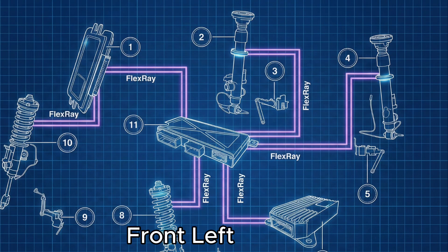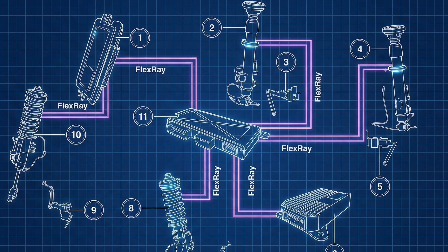And by doing that, you've killed the entire path — you've got an open circuit on that resistor. It's just like CAN bus: if you've got an open circuit, it ain't going to work. So that's why when we induced that fault, we knew we had good wiring in the whole of path five, either at the front left or the rear left. By doing that, we have no problem with it, and actually you could get a 95-ohm resistor and manually insert it. So if we take this line at the rear left damper — the one we disconnected to induce the fault — when we do that, we lose resistance on this entire connected line.